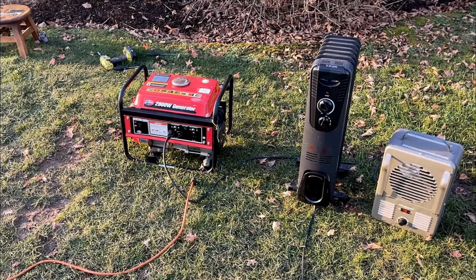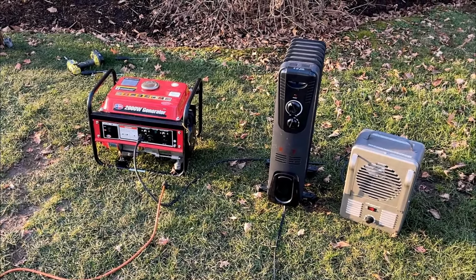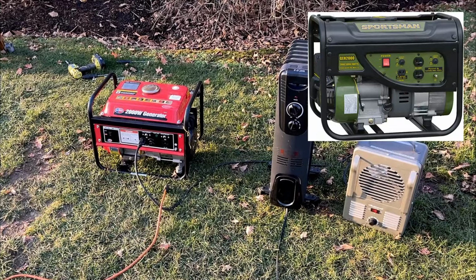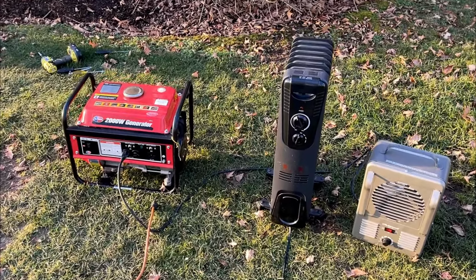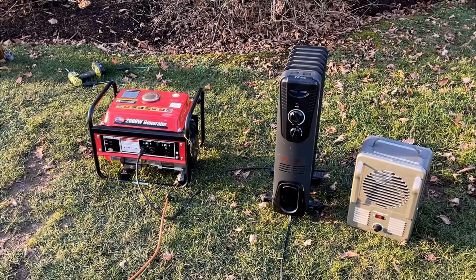Now, the interesting thing is, a few weeks back, I did get an email from a subscriber. He has a Sportsman Gen 2000. It's essentially this generator, just rebranded. And he was having similar issues. His was surging without a load, except his carburetor did not have that needle. So he ended up buying a new carb with the needle, and he was able to sort that issue out.